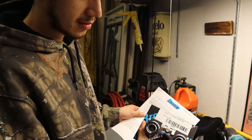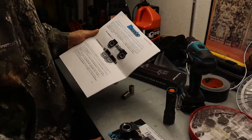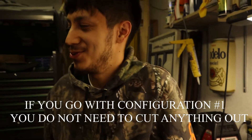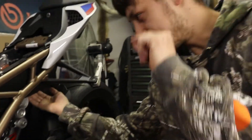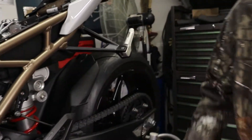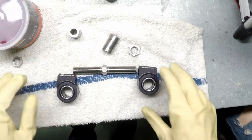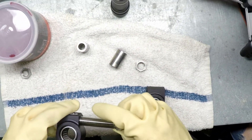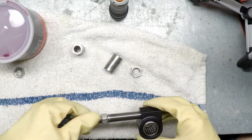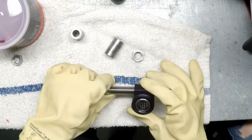Right now it's configuration one — I'm going to switch it to configuration two because I want to get this bike as low as I can with the stock shock. To do that, we need to cut out underneath this tray and move the battery regulator to let the shock go up more. What you need to do is flip this one around and flip this one around. This is a left-hand thread, so righty-tighty is actually lefty-loosey, and lefty-loosey is righty-tighty. Go ahead and screw those all the way in.